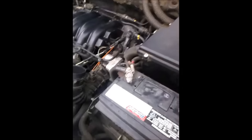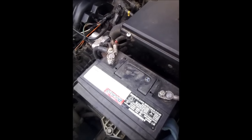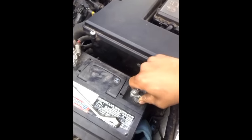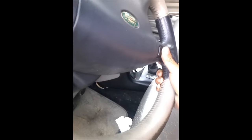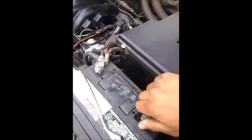If not, here's the other way to do it. This second way you can do with the key off — you don't have to put the key in the ON position. You will disconnect the negative cable of the battery, then go inside the car and keep pressing the horn for 20 seconds. After you press it for 20 seconds, release it, go back to the battery, and connect back the terminal. That's the second way.